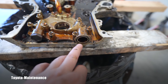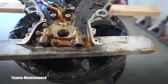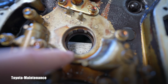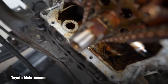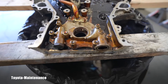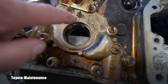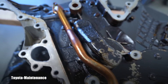When installing this, be careful not to pinch the o-ring or let it fall off. Very importantly, beware of this area — that's the oil pump. These grooves you don't want to touch or move elsewhere because they correlate to the position of the main crank. If you try to do this alone, don't let this spin to a completely different position — it sits loosely there. Observe the position; it's basically toward this mark here.